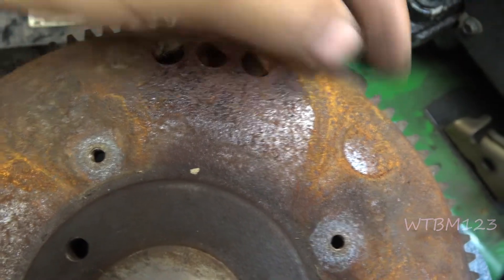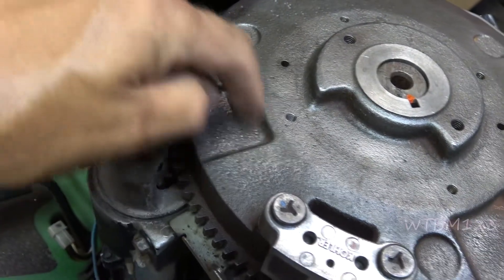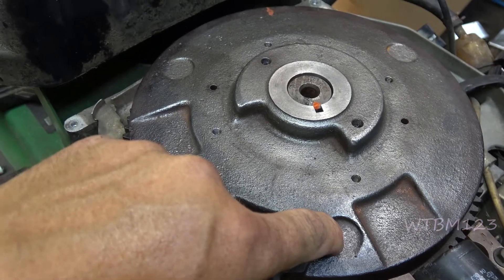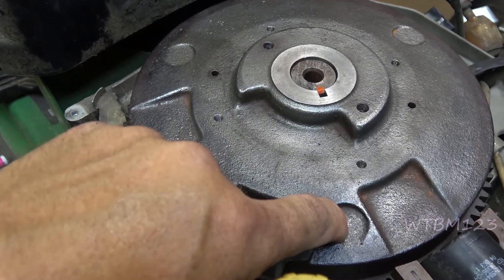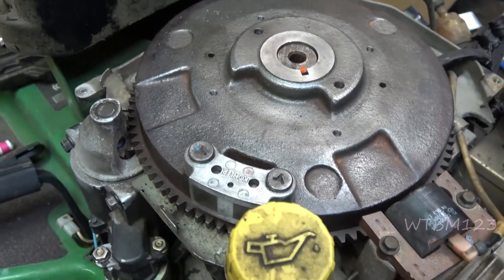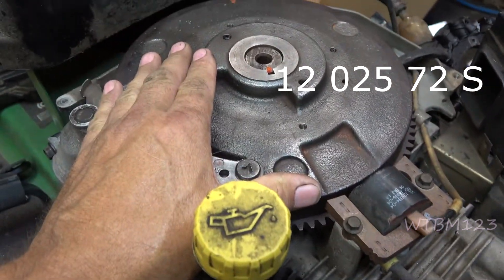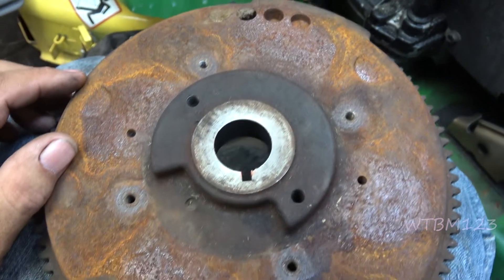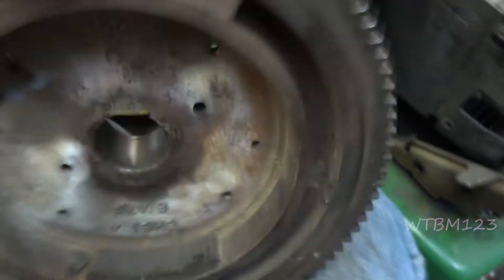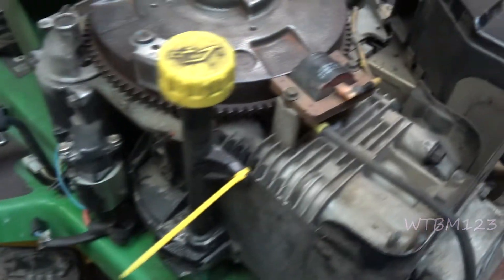My original flywheel has no indentation over here and has this area protruding out just a little bit. This new one is smooth in the back and has two protrusions pushed in, not just the one single feature. Every other flywheel I looked at on eBay with that same part number looks exactly like the one the seller sent — I'm not saying the seller did anything wrong. I'm just saying the parts listed for this engine call for this flywheel, not the one that originally came on it. It ran fine before; it's just the magnets that are gone.